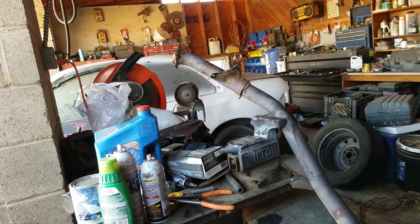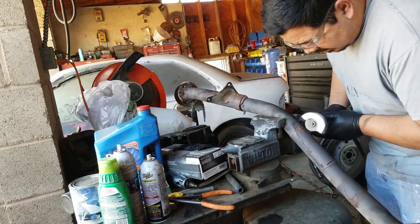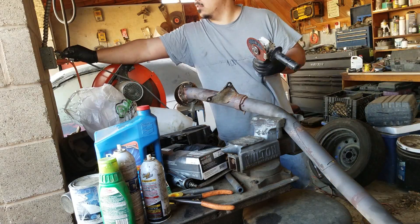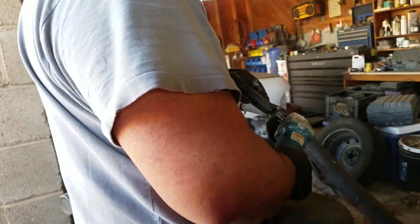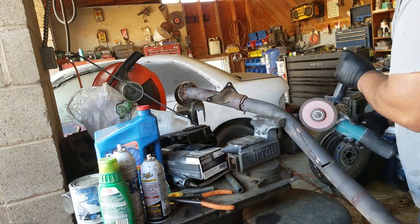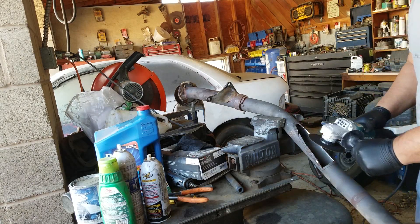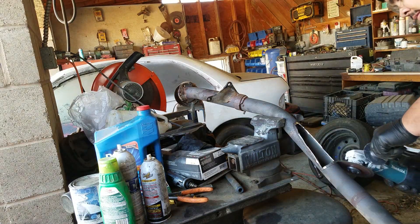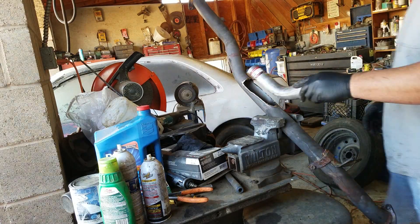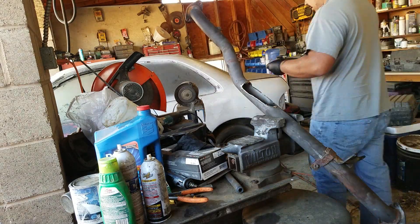What I'm doing right now is cutting out the pipe — you trace it out, cut a hole into your current pipe, and that way you have sufficient flow going toward the catalytic converter. I'm making the hole as big as possible to give the exhaust plenty of room to flow. As you can see in the video, I'm just tweaking the pipe a little bit to get it as close as possible so I don't have to weld any big gaps. I got my welder ready to go to weld that shut.